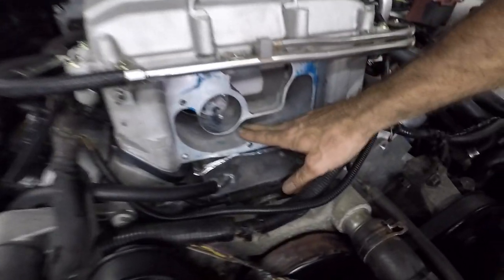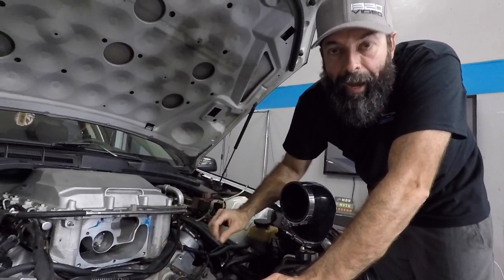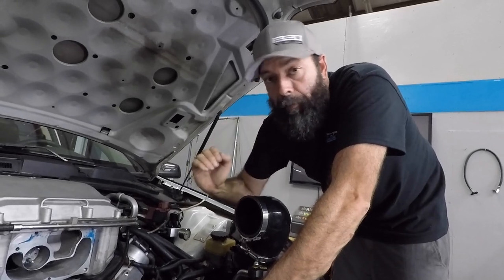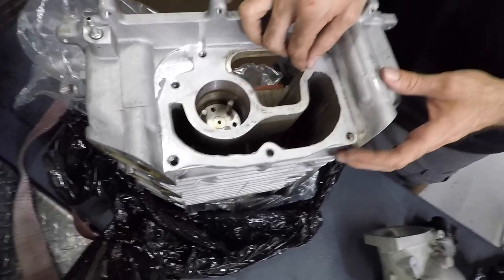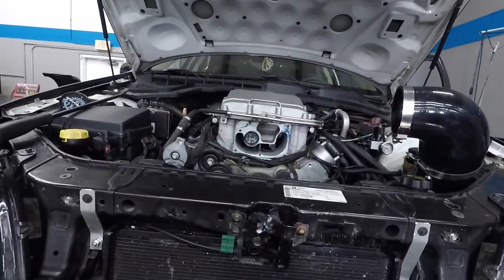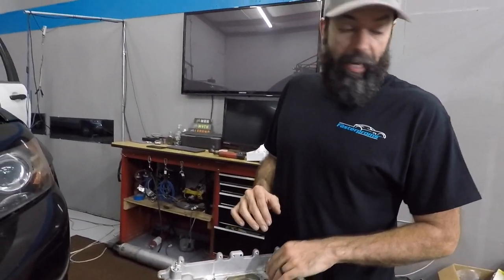This is very, very thin right here, but all of the areas that flow the most we take very aggressively to the limit. Check out how thin what we've done on that blower versus a stock blower. On the stock one, I'm going to call that a middle-finger-knuckle depth. On ours, we've got probably like an index-finger fingernail or so — it's to be envied. This does have some limitations, and the other part is the snout.